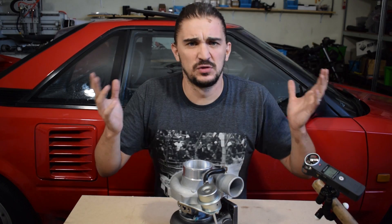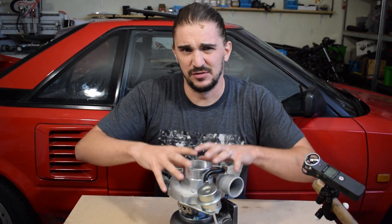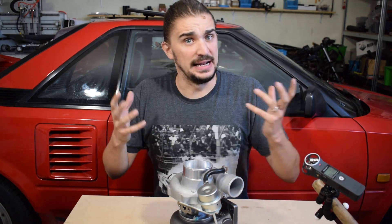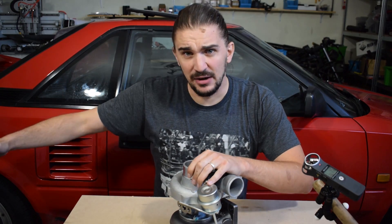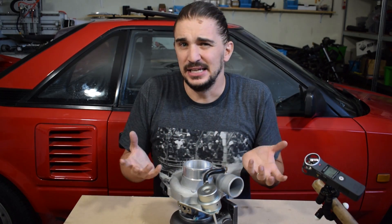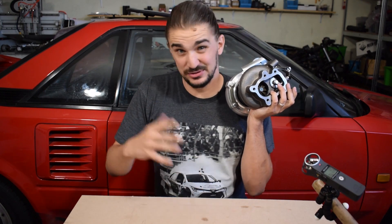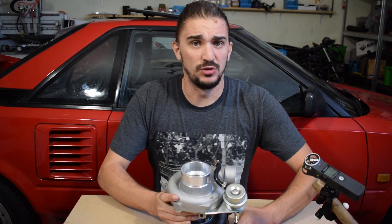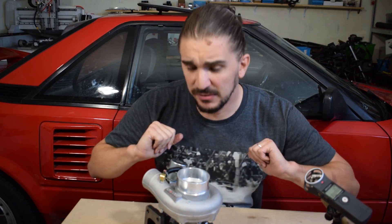And this thing lets you do that for the price of a slightly fancy dinner for two. That's a lot better than buying an actual Garrett. Let's say I want to try out this turbo size and I don't like it — there's too much lag, it makes a lot of power but it's not great for driving curvy canyon roads, because a mid-engine car from the 80s that makes a lot of power at 5,000 RPM is a bit of a deathtrap. I spent $120 on that experiment and now I know this turbo is too big for my engine. Compare that to buying a Garrett for over $1,000, not liking it, and having to sell it for half the price because it's now used — I've lost $500, $600, $700. We car enthusiasts should be grateful for these things as a reference point for your engine.